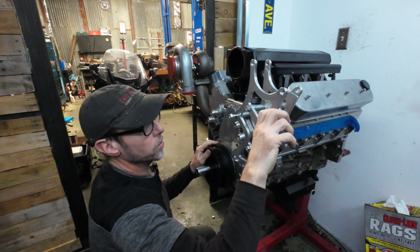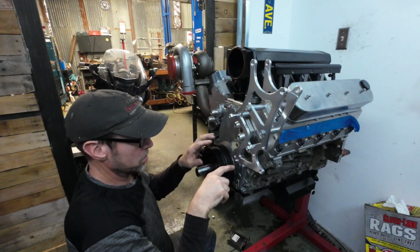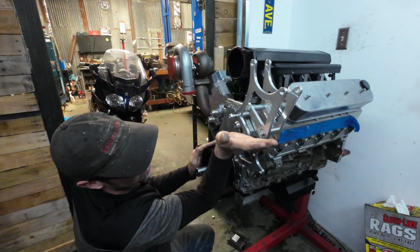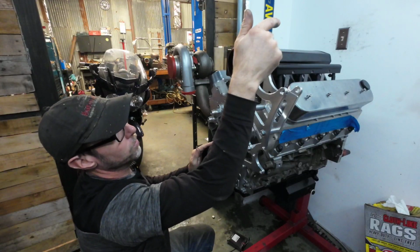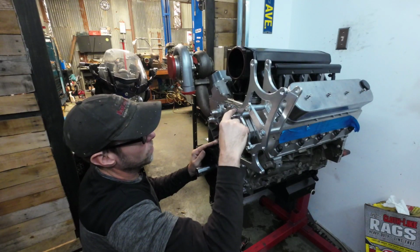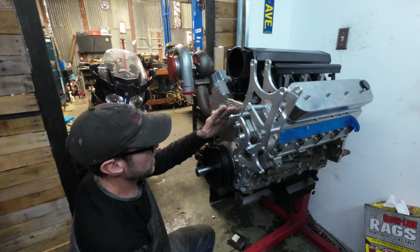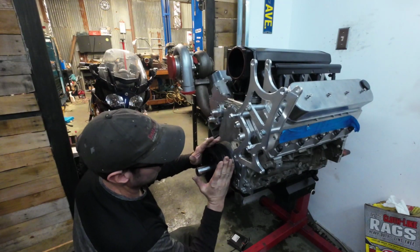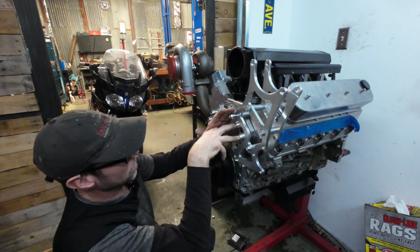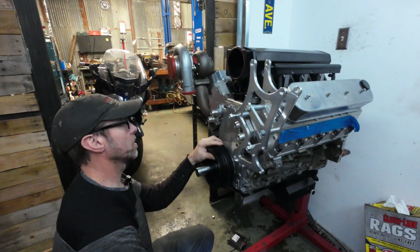And put another idler, grooved idler, so it'll come here, up, over the back of the power steering pump pulley, onto an idler, onto the alternator, back around probably to another idler to give it enough wrap. I just don't know if I can come across something here and have enough wrap here, which I would bet you that would work. And then it would clear, the hoses would have to come in between the belt, which doesn't excite me, but it would work.